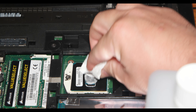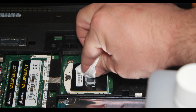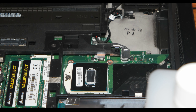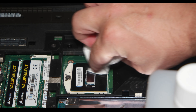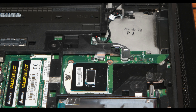Also the cooler for the CPU needs to come off. In order to clean the CPU, you can use ethanol or propanol, 70% and above — the purer the better, because it won't have much water and will have more ethanol or propanol. As you can see, this is the CPU without the cooler and fan, only with old thermal paste from 2014.